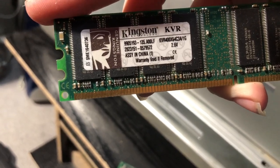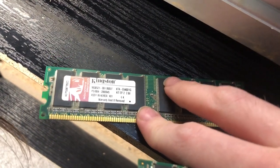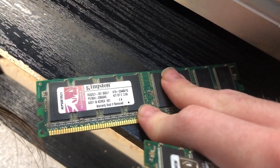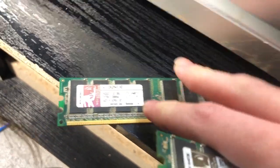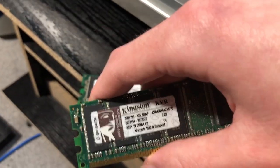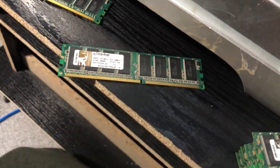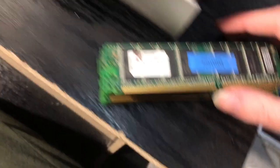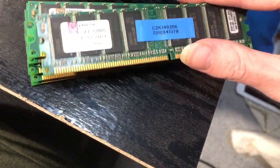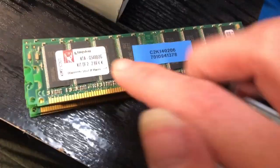I see 400 on here — so maybe there's a code thing that suggests 400, because I'm assuming the 400 means 400 megahertz. This RAM is DDR1, not DDR2. The late 2005 models are DDR2, but don't worry — these are all DDR1s.